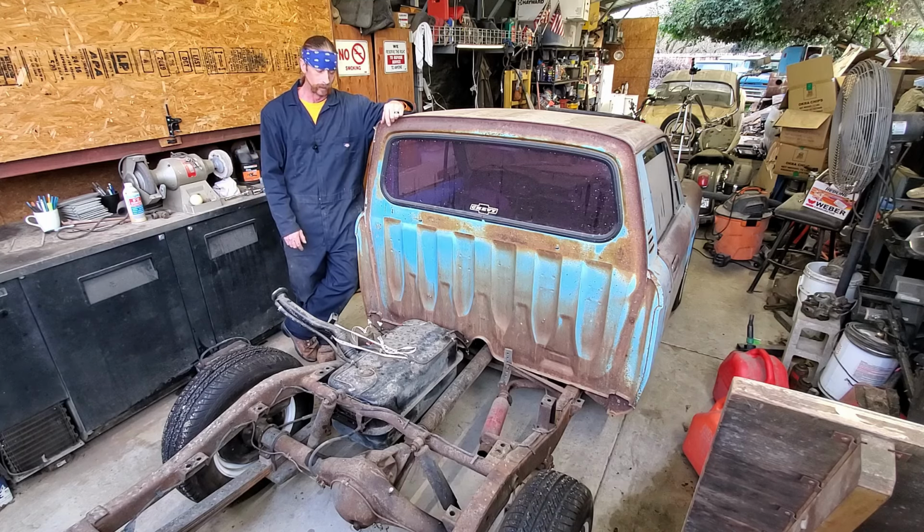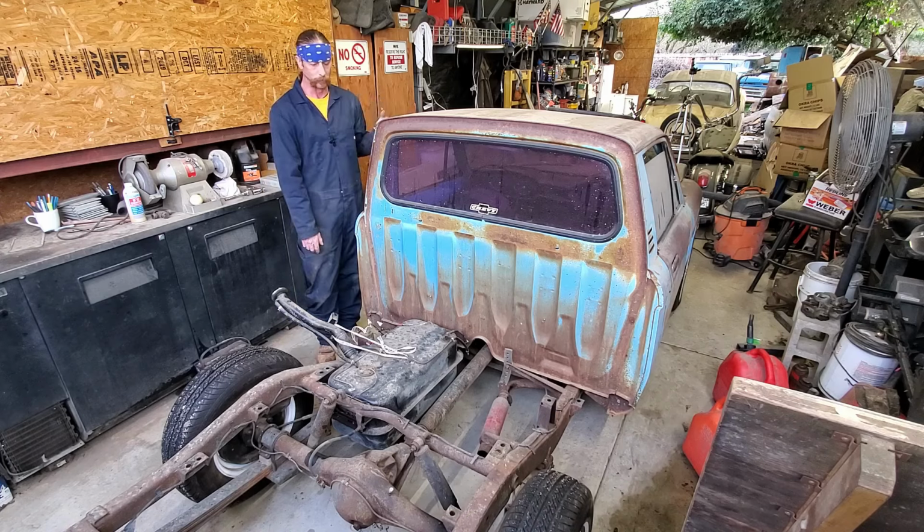Somebody said they need 4 to 6 PSI. And so I ordered a 4 to 7 PSI. Maybe that'll help. I think this fuel pump is enough. But I just want to eliminate this as an issue. Maybe it's the issue, maybe it's not, but I want to eliminate it so we know that we're good here. And then we can move on to whatever else.